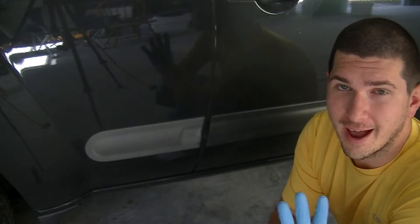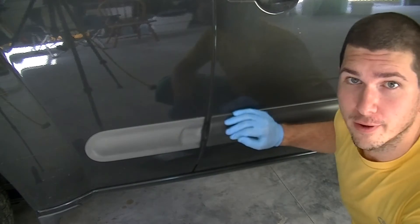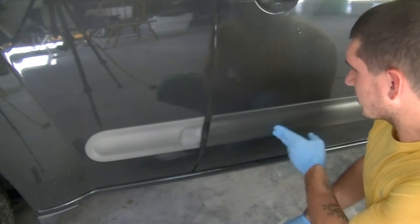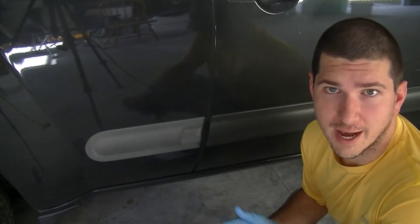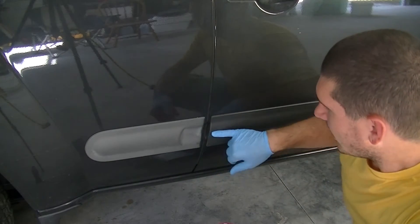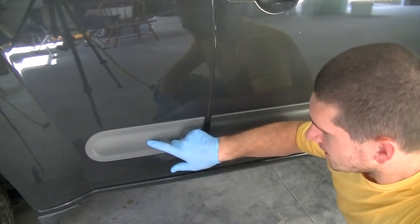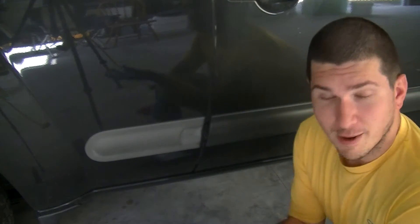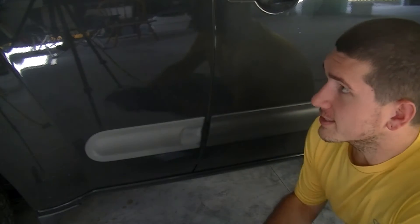I stopped here to show you what an absolutely massive difference this is making. So far I'm very pleased — this plastic looks almost brand new and this is only after one coat. I'm going to go back and do some touch-up because there's a little bit of discoloration where I didn't get enough solution on. I'll go over it again, maybe even a third time since this is the first time I'm doing it. Take a look — it's even evening out the colors. There's no more bright white or uneven gray patches. This looks like brand new trim, and since I've been pricing out replacement trim, this is a heck of a lot cheaper.